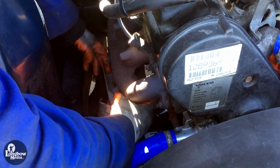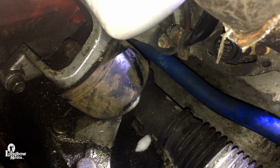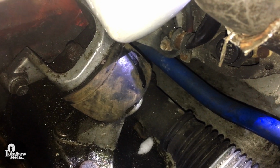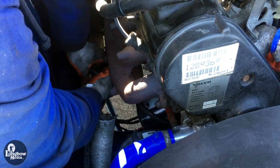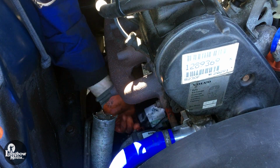and remove the assembly. Before removing the oil filter, you may want to cover the engine mount just below to prevent it from being covered in oil. You may also need to use pliers to initially unseat the filter, but then it should easily unscrew by hand.